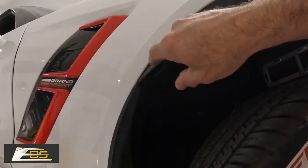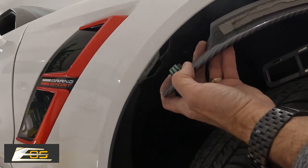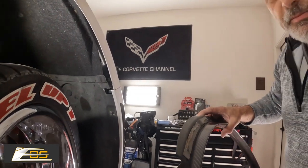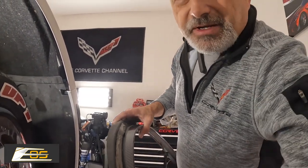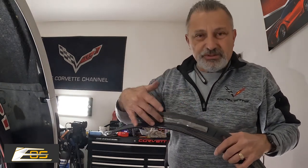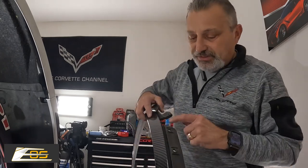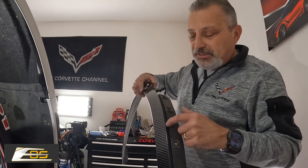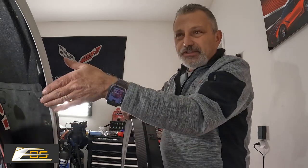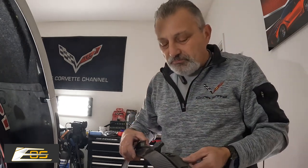So now you can see it's totally loose except there is a clip right here — you just pull it down and it comes out. So remember we were talking about the two-sided stick tape — here's the two-sided stick tape here and here, just like I've put back on the new one. But you notice there isn't any two-sided stick tape down here in this channel. I put that in just to make sure it's going to seal nice and pretty up against this fender well, because they do tend to want to move.